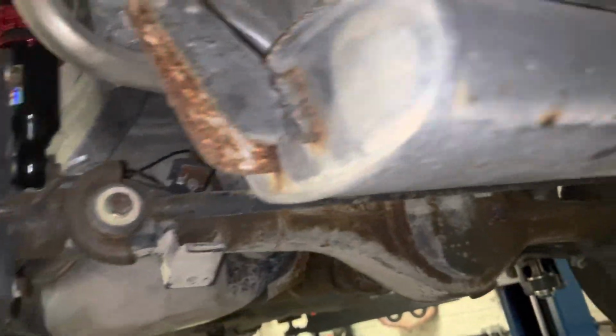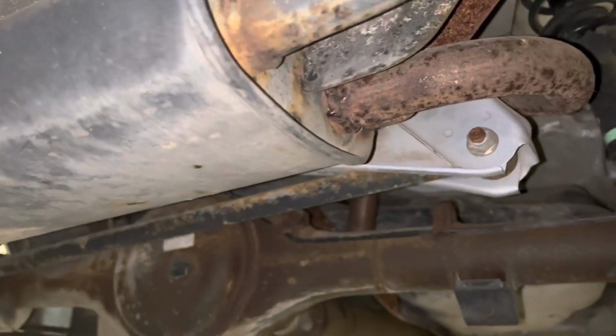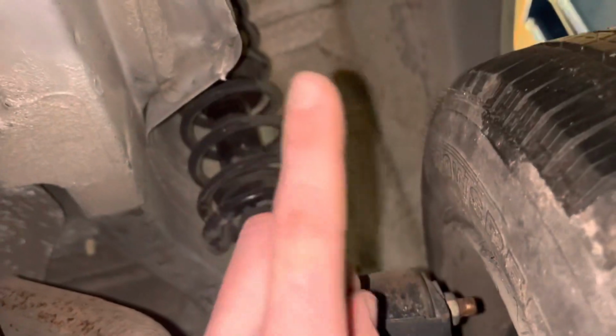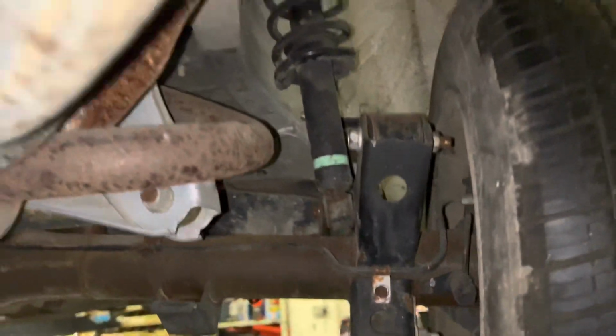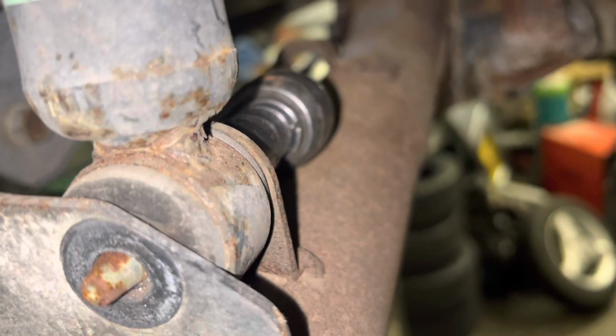Might sit a little bit weird, because obviously this shocker's a bit higher than the other, so it's on an angle. So I'm going to disconnect this one, and then 2 bolts at the top as the exact same. We'll get this one as well in. Okay, got that's on the floor. We'll get that in a second. We'll get this bolt out as well. Get this bolt out. No. It's stuck now because obviously the angle.